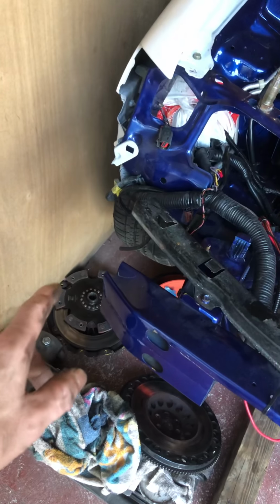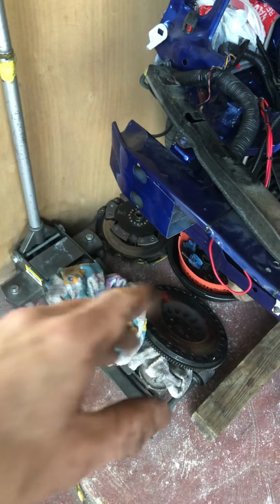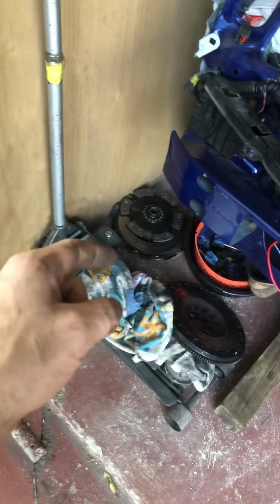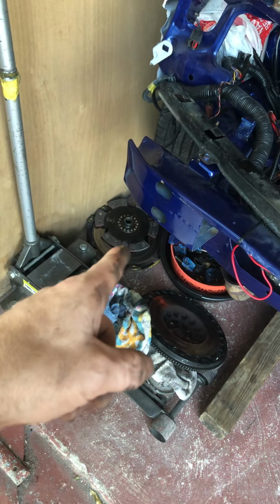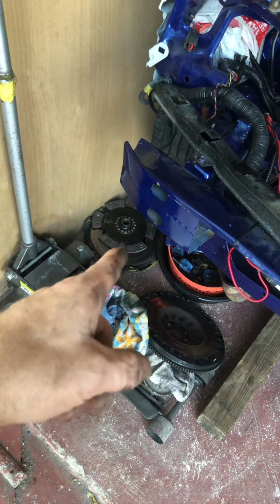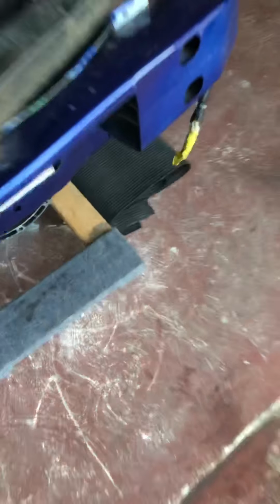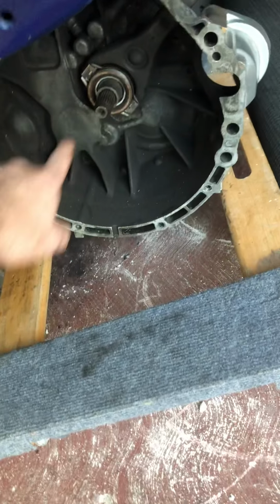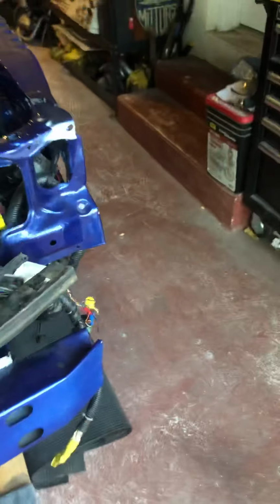Okay, so in order for my clutch to have been damaged, hearing those sounds and having the symptoms and the car not going anywhere, that means whatever clutch I have in there would probably have to be like a $2,000 clutch in order to withstand abuse and outlast the transmission. But you always got to remember, if this part here is made of an even tougher metal, what's going to happen is it's going to end up stripping the shaft on your transmission, and it's a lot cheaper to replace a clutch or a clutch disc than it's going to be to replace the transmission shaft.